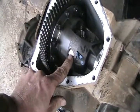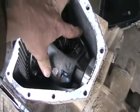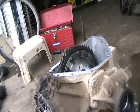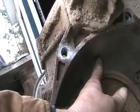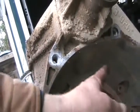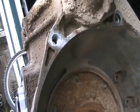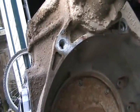As you're driving along, centrifugal force causes that shaft to just come out. When it comes out, it doesn't quite come out far enough to hit the metal cover very often, but it comes out far enough to hit the aluminum case and housing — the part it likes to hit most is the inside of the bell housing. If you took your transmission off your car that had that leak, you would see a little cut there. That shaft, when it's whirling around, doesn't even make a sound — it just rubs on the inside of the bell housing and very slowly cuts a little trench. Once it starts leaking, it will never get better, and the faster you go, the more it leaks. When you park, it stops leaking because the oil level isn't anywhere near that high.